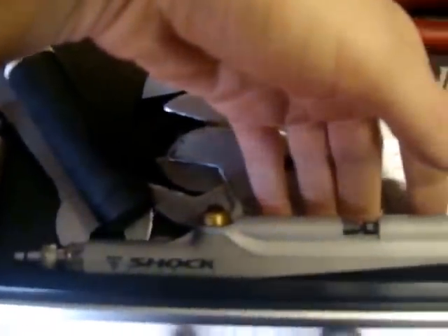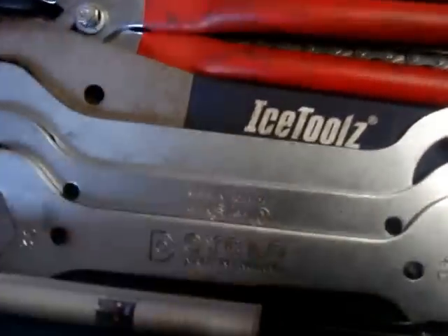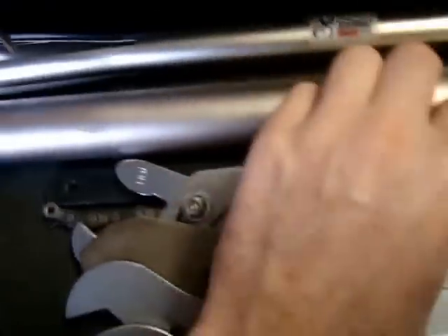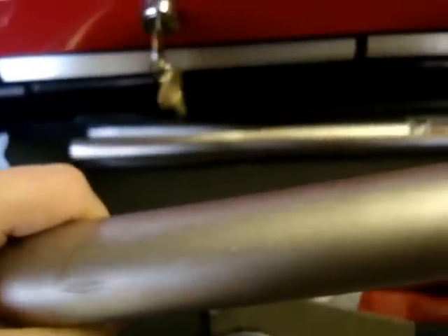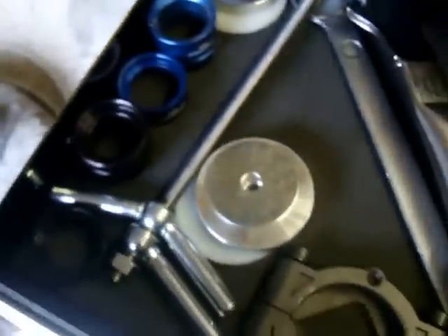Next one down, again this is a bikey one. I've got my fork pump from the Cannondale, my headset spanners for the old fashioned bike — which you don't need these anymore. Bottom bracket tool for the Hollowtech 2, adjustable cone spanners, chain whip for getting the cassettes off, and the headset cup press — I need that and the various spacers, whichever size headset you've got: inch, inch and a half, or inch and a quarter.